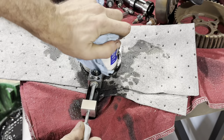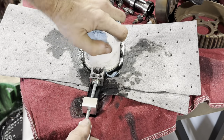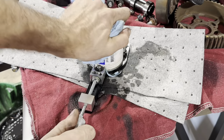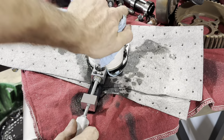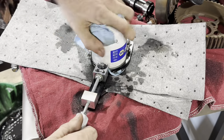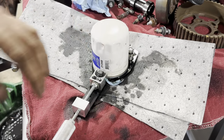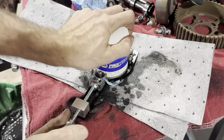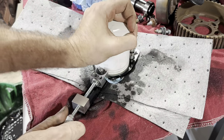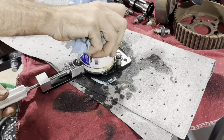Too tight — I cut my towel, you see that? That was cool. I know I'm just a big kid. Okay, we're getting through. I'm doing this by feel — every time it gets real easy to turn, I give it a little bit of a tighten on the rod here and it will push that blade inward slightly, creating more pressure for cutting. I need to get like a master set of oil filter cups and put that on the end of an impact gun to use a gun to do this — that might be really cool and it'll save my flanges from fatigue. Okay, we're getting through it. There we go, we're in.